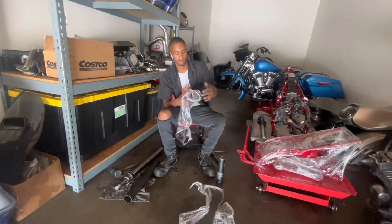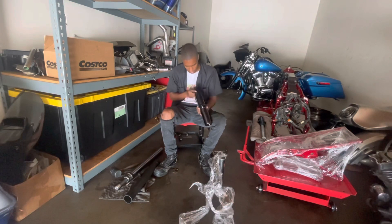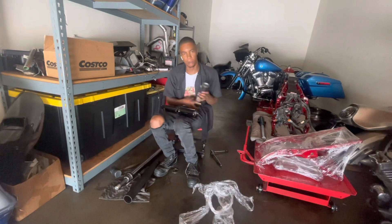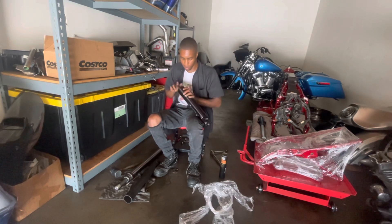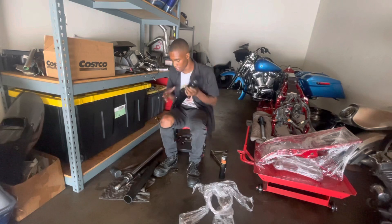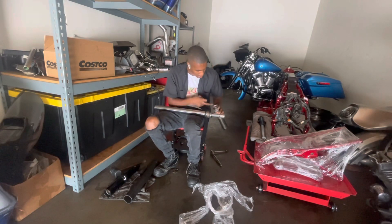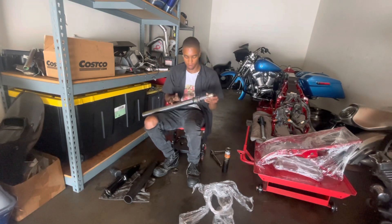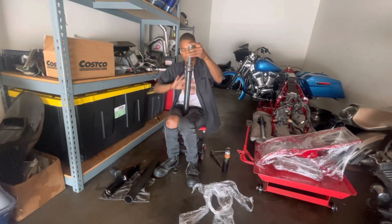It's amazing, man — it makes this thing look good. So we're about to do the same thing. Put the grease inside all around. Once you get that grease inside, you want to put it around the leg too — it's going to make it slide nice and easy. Get this thing going around. I'm going to slide it. Got the leg greased up. I'm going to actually move the seal in the middle — it's going to make it even easier. Put it all around the middle. It's going to make the whole job nice and easy.